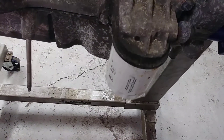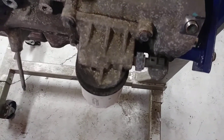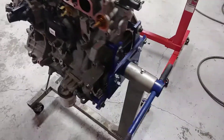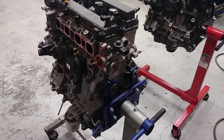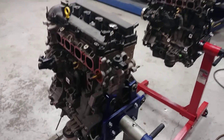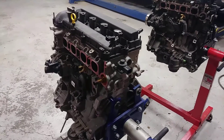I'm going to run that setup that's on here, turn it into a spin-on filter. But there's a difference between the green and the gray colored oil sending units — meaning they're calibrated differently when you put them in the car. I changed it on my car because I knew that was a problem going in, so I didn't want to deal with it later.